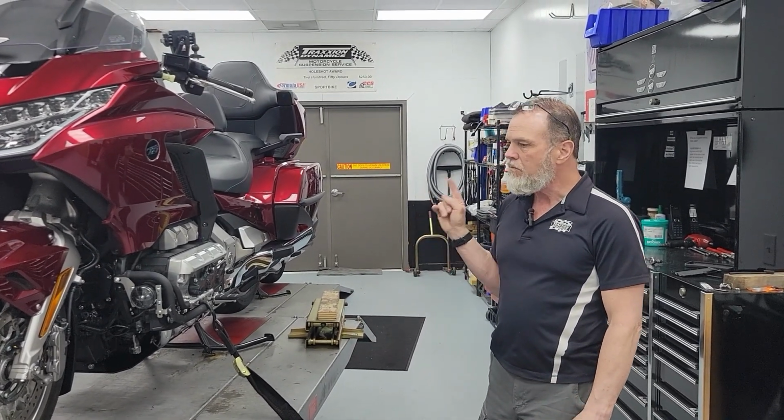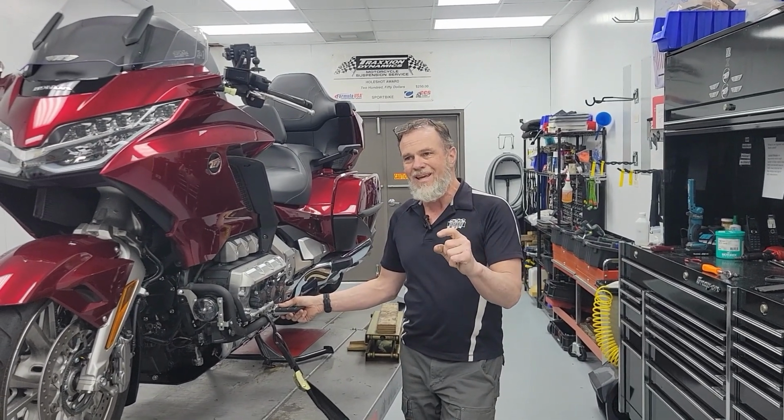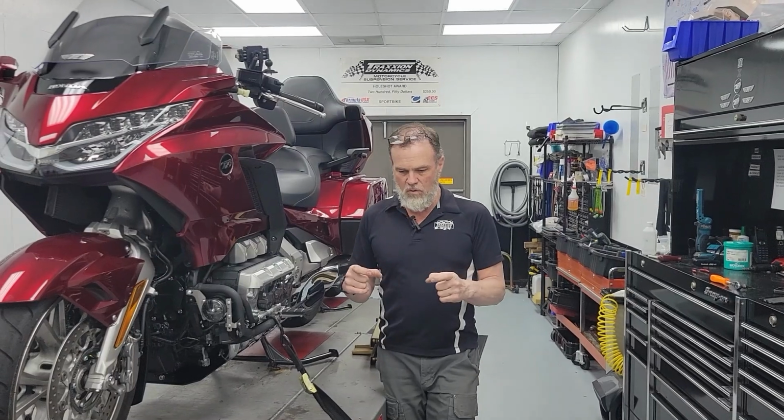We've had one in a tiny handful, I don't know what the number is, 1 in 50, where one of the screw holes won't line up. We include a washer in the kit that goes behind the left rear bracket mount. But going forward, we're taking the 3 holes in the back of the plate and slotting them slightly so that no matter what, there won't be a misalignment.